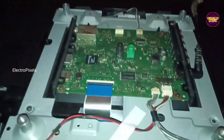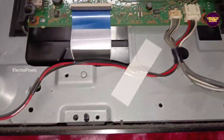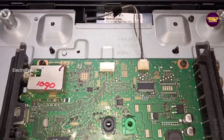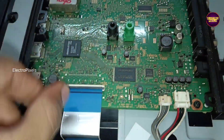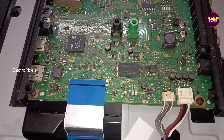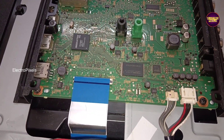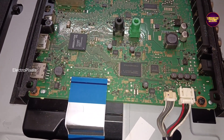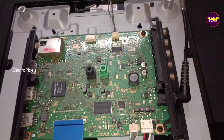See friends, this is the fault. As we discussed earlier, these types of complaints are mainly due to internal shorting in gate signals inside the glass panel. The shorting may be either from the left side or right side of the glass panel.